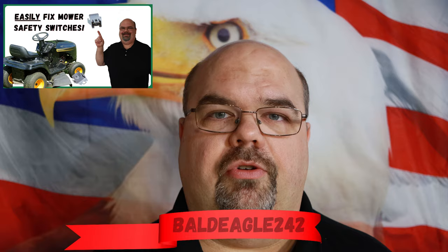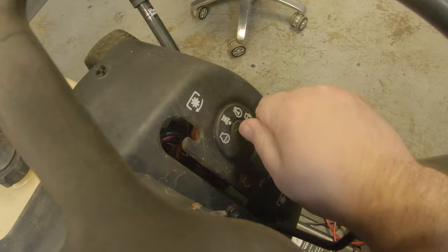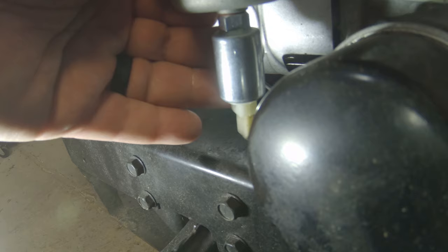The first thing you'll want to do is check the solenoid on the bottom of your carburetor to make sure it's working. The simple way to check that — just turn your key on and off. Put a finger on it or hold it; you can listen and you can feel it. I'm flipping the key on and off, and that's how you check this to make sure it's working first.